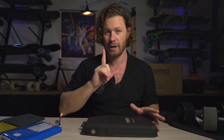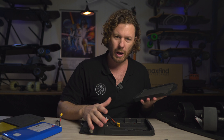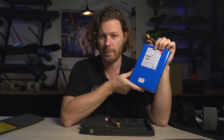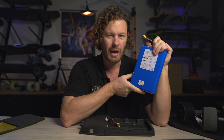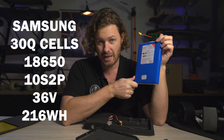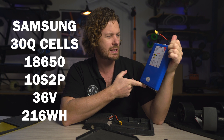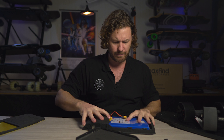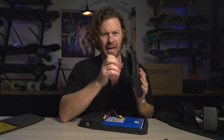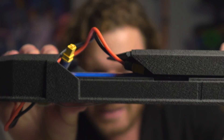The next thing is it's designed to allow you to change the battery. Why is that important? Because battery technology evolves rapidly, growing in capacity and getting cheaper. You don't really want to be tied into a pack that is not upgradable. This battery pack is made with 18650 size cells and uses Samsung 30Q cells, giving you a total of 216 watt hours — it's 10S2P. It does take up most of the space, but this case actually has heaps of room in it. Look how much spare space there is when that lid's on. It's huge.